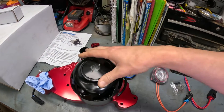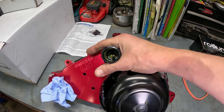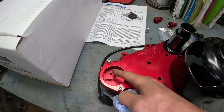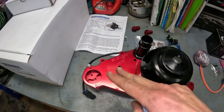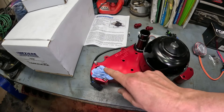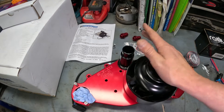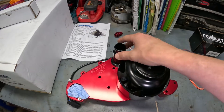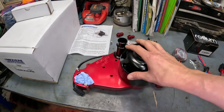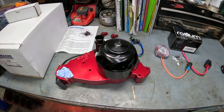The thermostat is moved into our outlet, so your traditional thermostat housing you have to remove according to the instructions, otherwise you would have two thermostats. I'm curious if anybody knows why they moved the thermostat from the factory location — the inlet — to the outlet. I imagine it's part of emissions control, having a factory engine warm up in a certain time frame, whereas this probably prolongs the warm-up. It's a better setup, just like an old small block Chevy would have it.